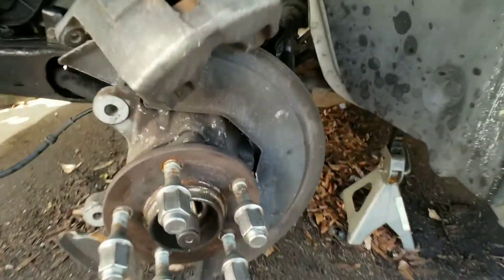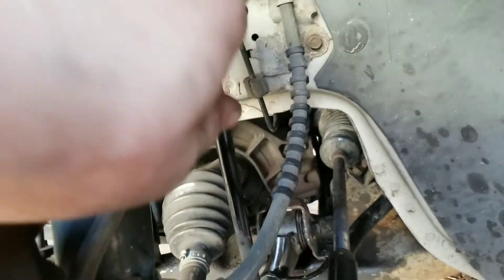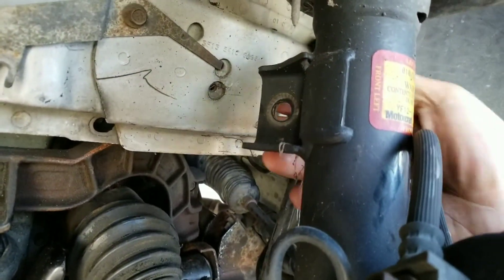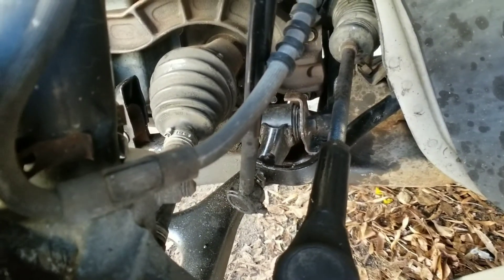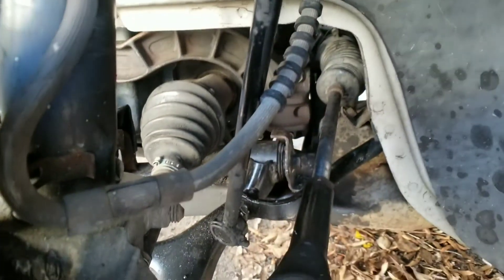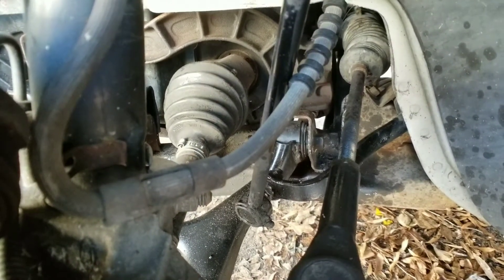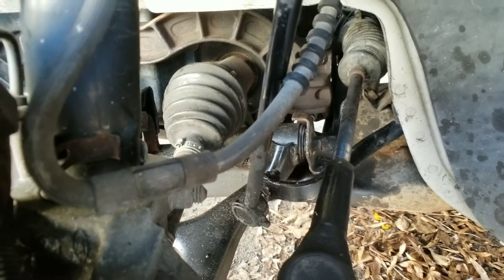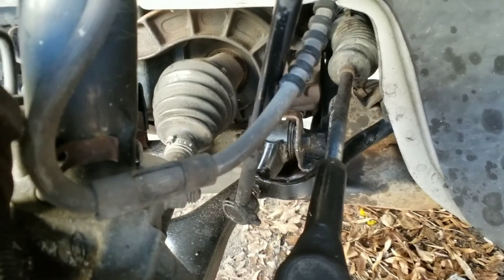If you're lucky when you're trying to get the stabilizer bars off, all you need is an 18mm wrench. Your stabilizer bar hooks into your strut through this hole right here, and it's held on by an 18mm nut. The new stabilizer bars are identical to these. Unfortunately, these have been in here so long that they're seized up, and when that happens we just got to cut it out. I'm going to grab my cutoff wheel, we're going to zip this off real quick — this side and the other side — and then I'll show you guys how to put on the new ones.